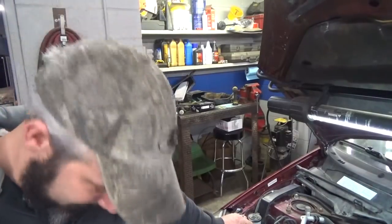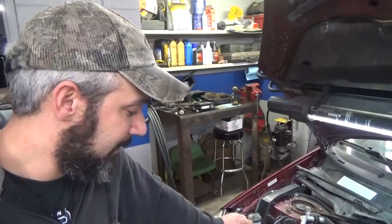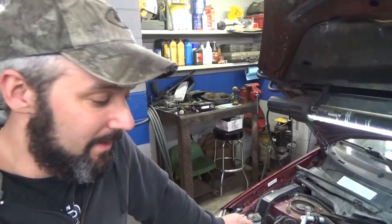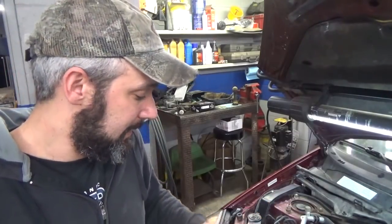I don't know, but anyhow, it's my mistake. I need to take it back off. I don't have any of the bolts tight. I just put them all in finger tight. And as I was putting them center bolts in, it just dawned on me, I got in a hurry and I just did the outside perimeter of the timing cover.